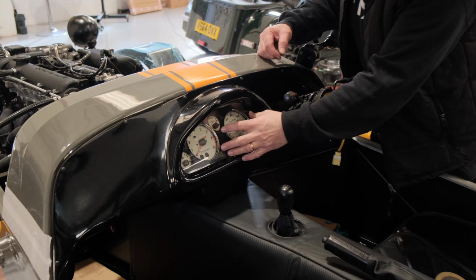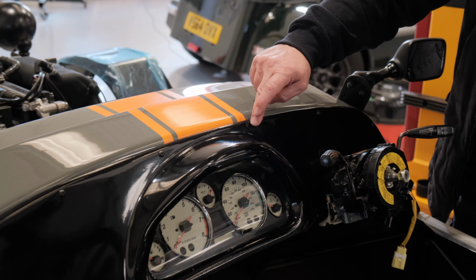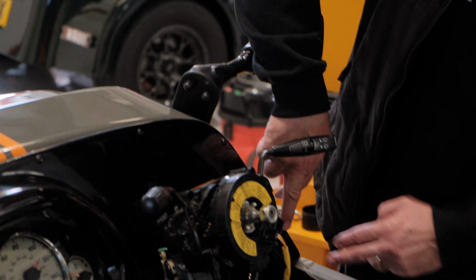You can try and do all these hidden fixings, but we're trying to standardise by just doing a bolt section here. So what we have here is, if you take from the centre right there and then go out 200mm, so it's 100mm either side, and then we go 170, 170, 170, so that's it there. So we go from centre 100mm, then it's 170, 170, 170. You end up with a nice number of even fittings around it, giving you the 8 fittings.